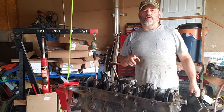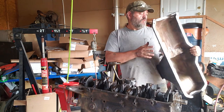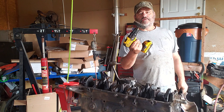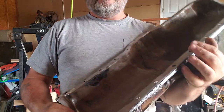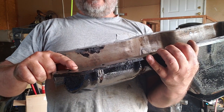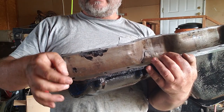So we're going to put the oil pan on. There are a couple things you want to check before you put your oil pan on. One is make sure your surface is spotless — nothing worse than putting an engine together and having a seeping oil pan. What I like to use is a drill with a plastic wire wheel — kind of like a pot scrubber but a little harder. You can get it at any hardware store. It's not steel so you don't have to worry about damaging the metal and you can get a pretty good finish. Next thing: check your holes, especially on these older pans. A lot of times somebody will have a leaky pan, they'll just tighten the bolts, and you'll get little dimples. Make sure these holes are all flat — if not, just take a ball-peen hammer, set the round part there, and give it a crack. It'll push that back down without distorting the pan.